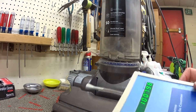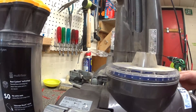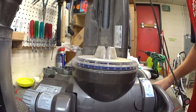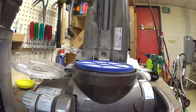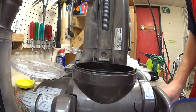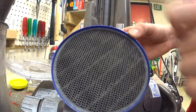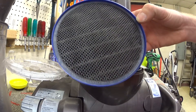There's some inconsistency, and I'm going to show you why. What happens is you have a plastic cover that holds this HEPA filter down, and the way it sits in here you can see from where the dust is escaping and not escaping. Basically what has happened is part of the gasket is gone and part of it is not.